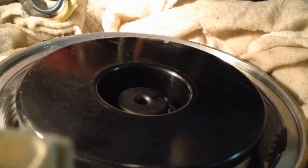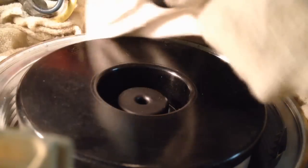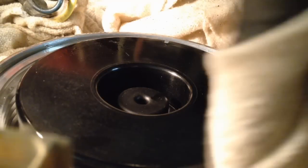So go ahead and put your new fuel filter in here slowly so you don't splash. It's going to be a little hard to push in. Make sure it's fully seated in there. Make sure you clean your rim here before you put that seal in.